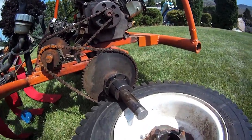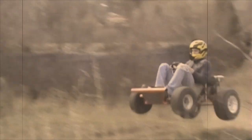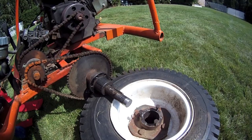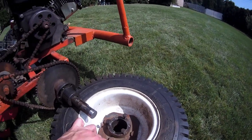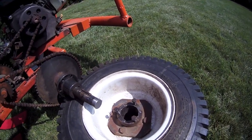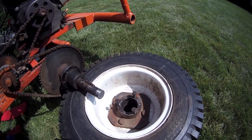This is my axle — it's 3/4 inch round cold rolled spring steel, so it doesn't bend. My first axle, I took it off a big jump with no suspension and it bent the axle so it was like a big massage chair going down the road. So here we have the hub assembly, and this part I made myself — cut and welded it together, then put it on the lathe so it fit inside the wheel well. That's all made by me.